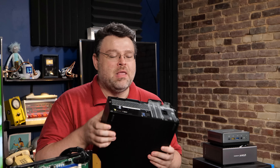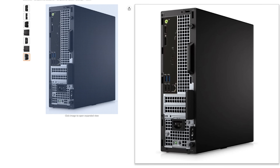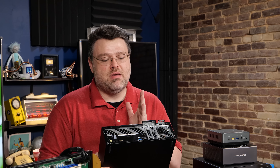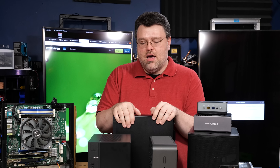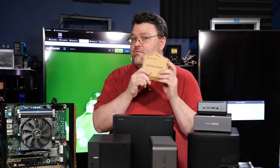The nice thing about this chassis is it's got two expansion slots: an x16 slot that's half-height and another PCI Express x4. Different Optiplexes have different PCIe configurations — some might be x16 by nothing, some x4 by one, some x16 by one. The downside is it's only got a single NIC. When you're running stuff in your home lab, you want multiple Ethernet interfaces — it makes virtualization easier. And on this older hardware you're probably not going to find anything faster than gigabit, which is a real problem. I've got a solution I'm really excited to show you.